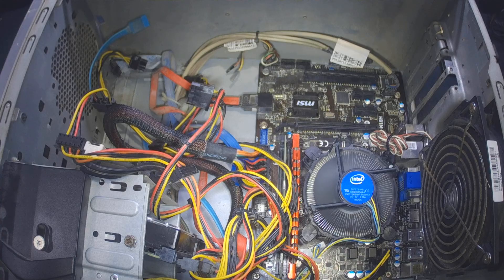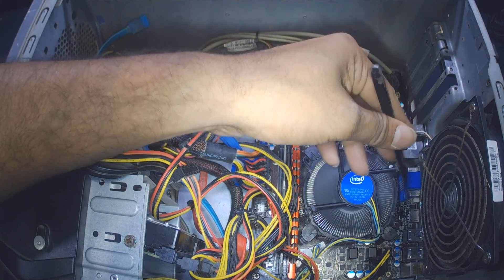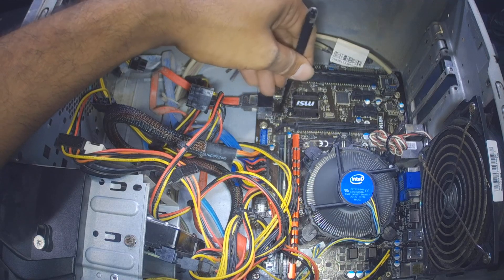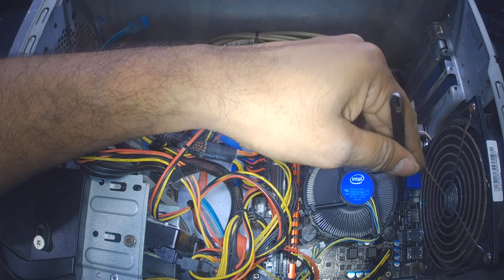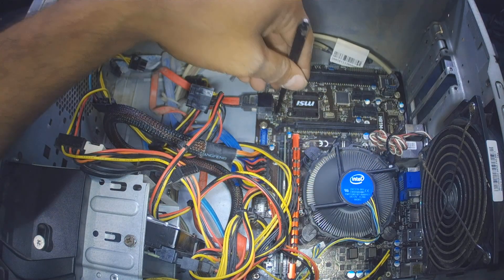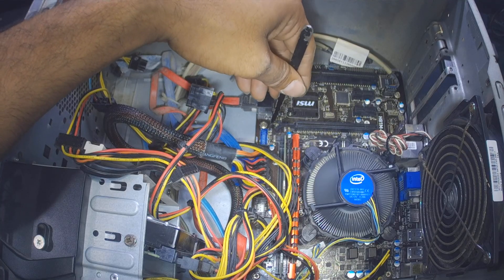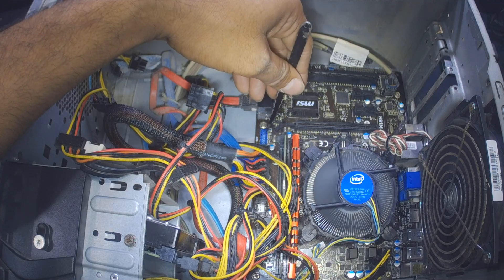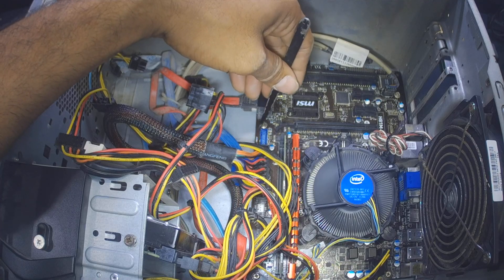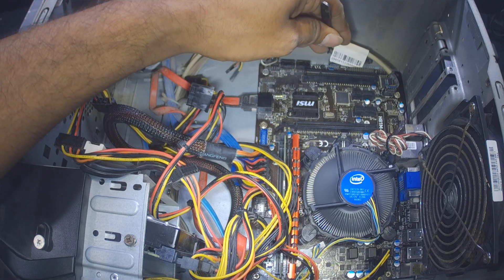The computer is on and working fine. I had disconnected all the USB connectors at the back and I thought there was no need to check that area, but I tried removing the protections one by one at the back side and was unable to resolve the issue until at the very end I removed this one protection and the problem was solved. I'm not going to replace this one because only the front 3.0 USB won't work — the back 3.0, back 2.0, and front 2.0 are all working fine.